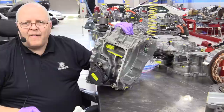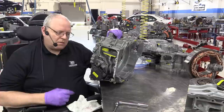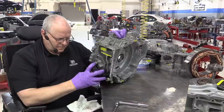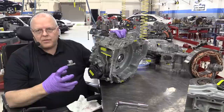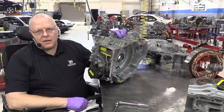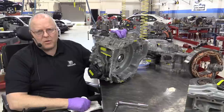And the P410, the brand new one, has special twist-off bolts that once you put them in, you can't get them out unless you go through a special procedure to come in sideways with a hand wrench. And like I said, the only thing I can think of, the reason for that would be to prevent somebody from accidentally taking the shift control actuator assembly off the transaxle while it's in park and maybe not properly blocked, as far as blocking the wheels, blocking the vehicle from rolling. Maybe this would make them think twice, make it harder to remove. I don't know. Maybe if one of you guys know, you can let me know.